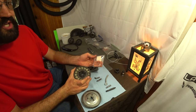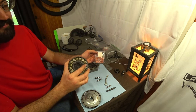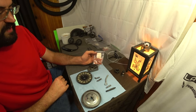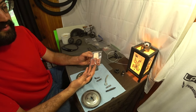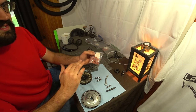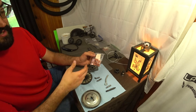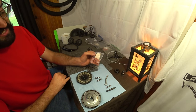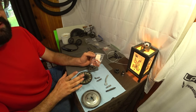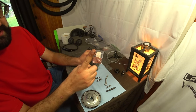There are two types of clutch pads I've experienced with these kits: the super cheap pencil-eraser type and the more quality pads. You'll find the cheaper pads on things like the Sutek PK-80s and usually the Firestorm triple 40s. Both are fine for stock motors, though the cheaper ones tend to make a little more noise and can squeak occasionally. They don't grip quite as well as the quality clutch pads, but for a stock build on a 26-inch bike or smaller, you just don't have enough torque to cause them to slip. Both sets have break-in periods — after the first few rides you'll likely need to readjust and take up slack, but you'll usually only have to do that once, maybe twice.